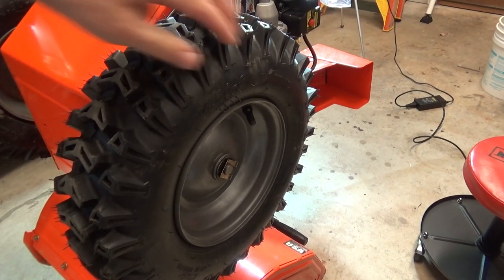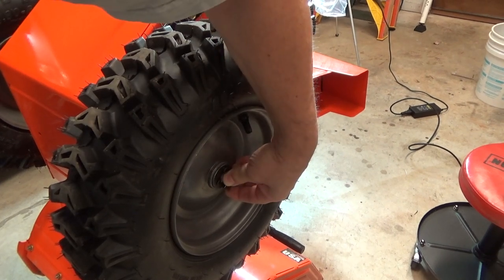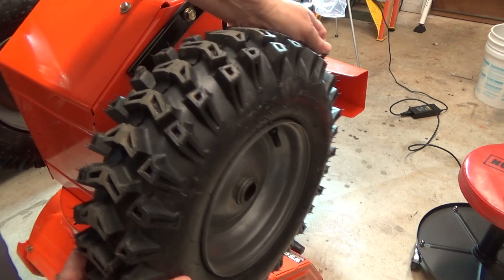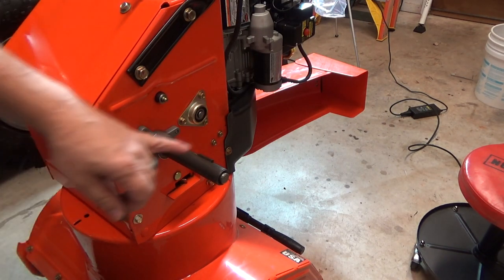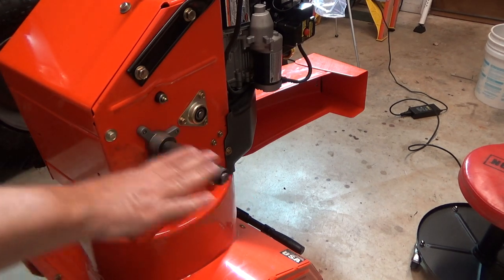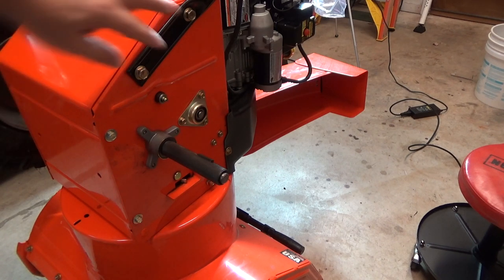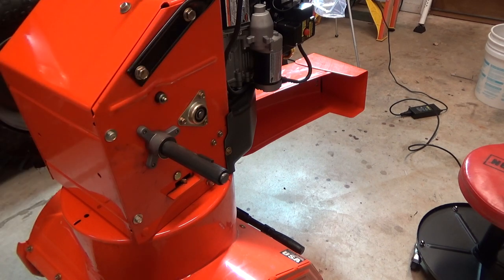This particular model is easy — the wheels come off. You just remove this stay clip and then the wheels come off. What you want to notice is there is a key. We're going to grease this area in here too, to allow the wheels to come off in the future. It also exposes the Zerk fitting — put a few squirts in there.